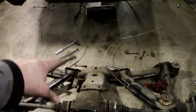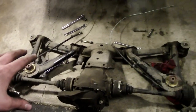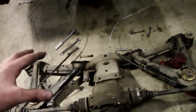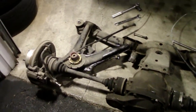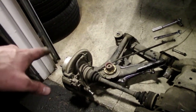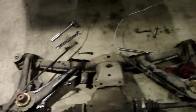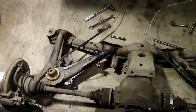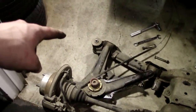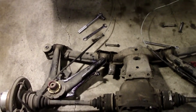The subframe is out completely now. I forgot the wires for the E-brake — that was pretty easy. I just lifted it back up, unbolted them from the handbrake, and fed them through the lines. And then there was the ABS sensor. I forgot that. But now I have the trailing arms all unbolted and the diff unbolted as well. I'm hoping to move this as one whole unit other than the subframe bushings.